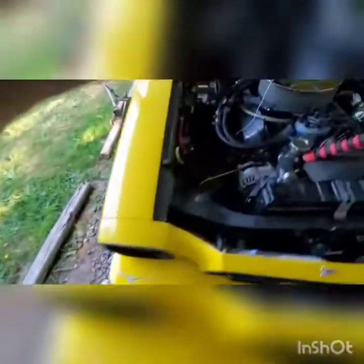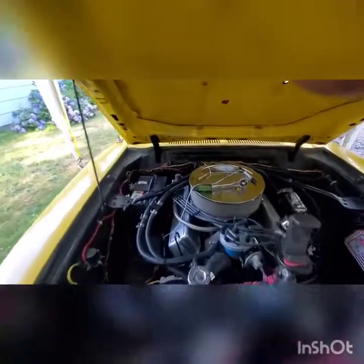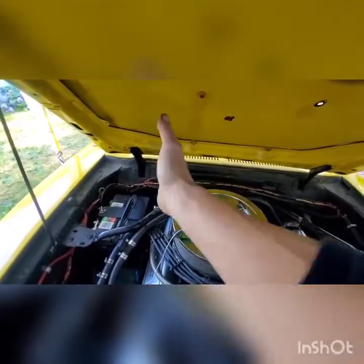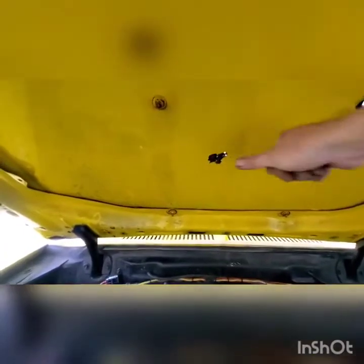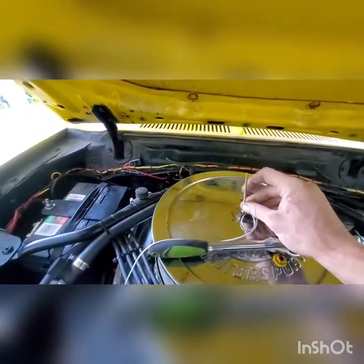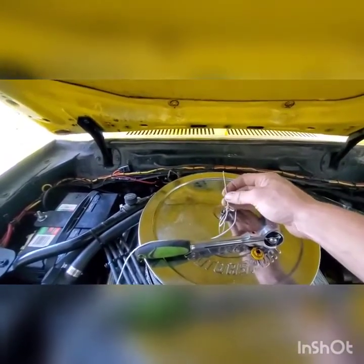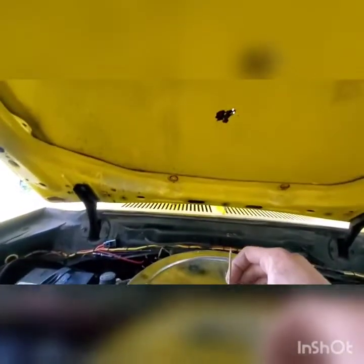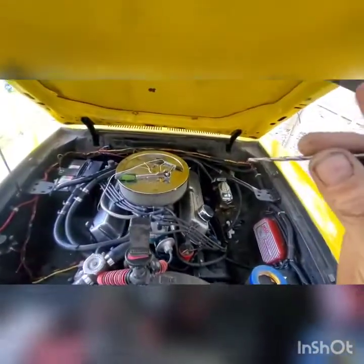To figure out where the hole is going to go, remember the air intake is to the passenger side — so it's to the left of you if you're staring at the car. It's not lined up directly with the bolt holes. What I did was place this little guy here, shut the hood, and made a tiny little mark with the tip of a screwdriver. A shorter one might be a little more accurate. Close the hood, make a mark, then drill a small pilot hole as a starter — I'm being super timid about putting holes in my car.